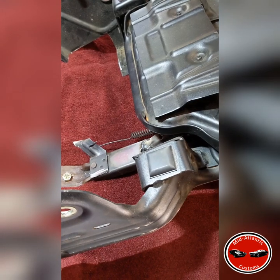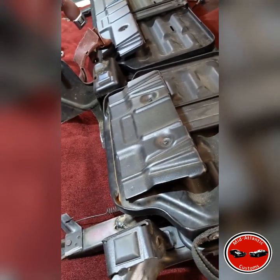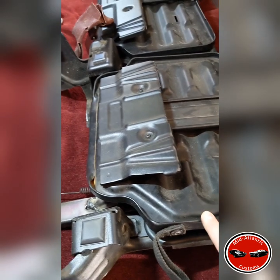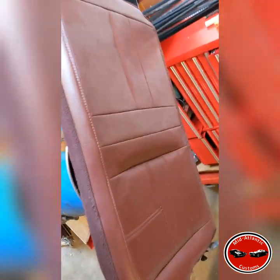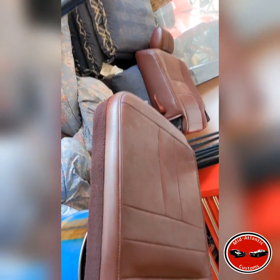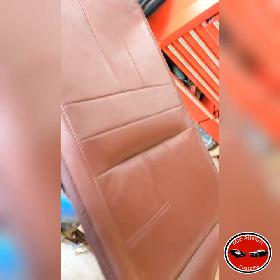These tracks are identical — or almost identical — for all of the square bodies. Before '81 I believe the lever is on the side of the seat versus being in the front, but otherwise the tracks mount up exactly the same. So this Super Duty base should work for all of these square bodies. I have the seats sitting around the garage — we dyed these, they were originally black, and I dyed them garnet red to match the interior in the truck. I'll have a separate video on how we did that, but for now I'll get them in the truck and show you the fitment.